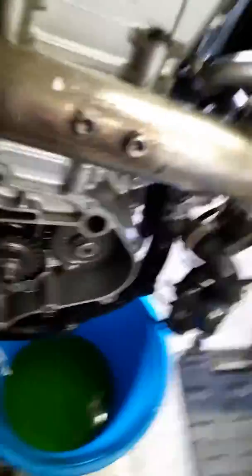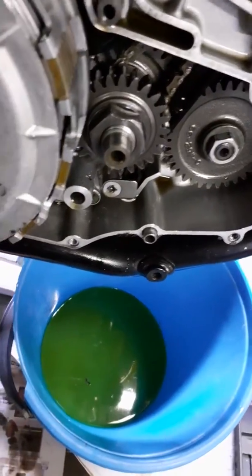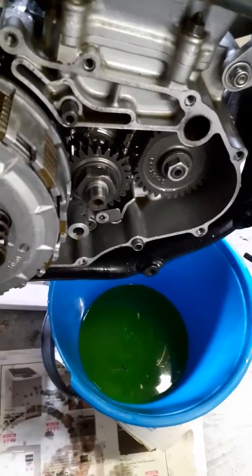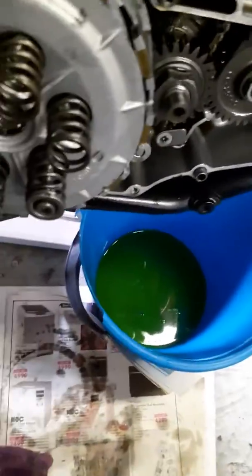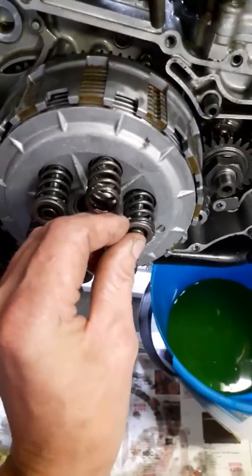On the Gen 1-to-5 I was not so lucky with that. But it still applies - if you don't tighten things evenly, you're going to have your clutch plates and steel plates rubbing against each other, causing glaze. Tighten properly.